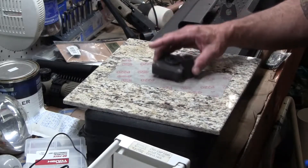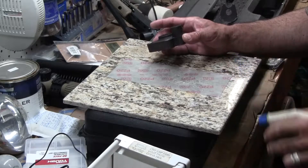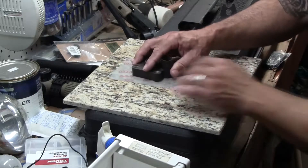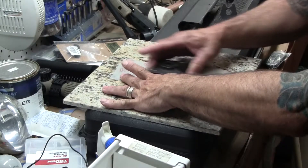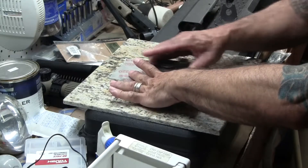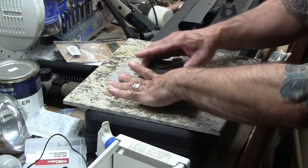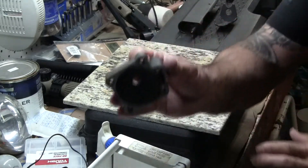So I've been working away on this housing. I've got cutting fluid on this 3M 220 sandpaper — it's not wet or dry but it's pretty much could be because of the plastic backing on it. Trying to smooth this thing out and I'll do the same thing to the base. It's already been worked some, as you can see, it's got a pretty decent surface on it.